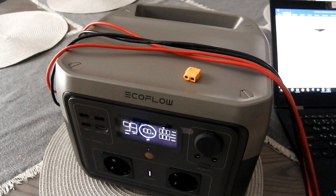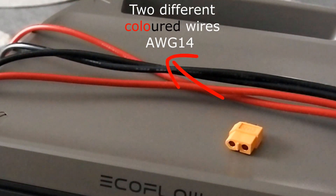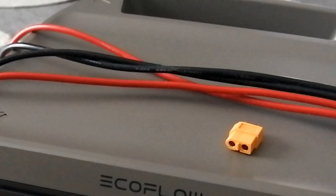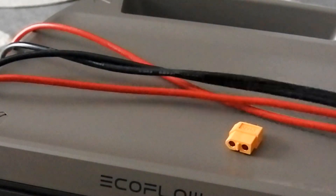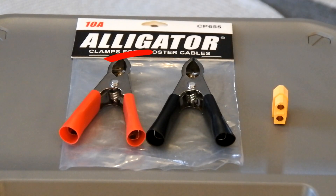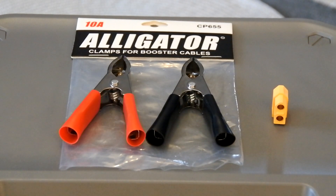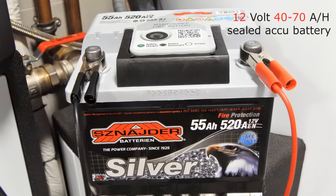We will need two different colored wires with at least 14 gauge, which are able to hold 8 to 10 amperes of current — better with silicone insulation. You will also need a pair of car battery clamps, so-called alligators. These clamps will be connected to the car battery terminals. You will also need a standard 12V car battery with a capacity from 40 to 70 Ah.